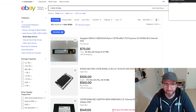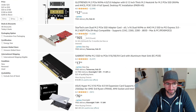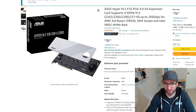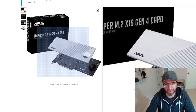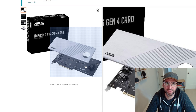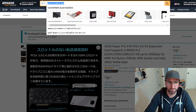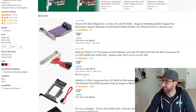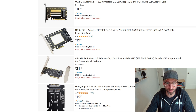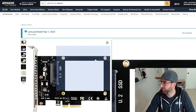For workstations, you might want to buy one of these PCIe M.2 add-in cards or adapters. You can find them used for around $40–$50. These support 80mm and 110mm Enterprise M.2s and will slot right into a workstation, bifurcating a x16 slot into four x4 slots. Alternatively, you can buy a PCIe to U.2 adapter — the Gen 3 one works fine for $20, and there's a Gen 4 one from Glow Trends for $21 that I use — that works fine too.